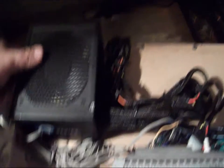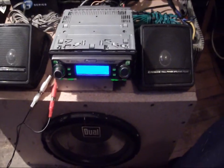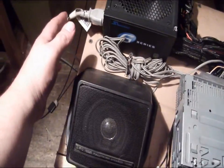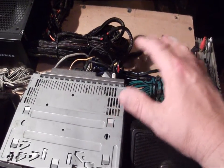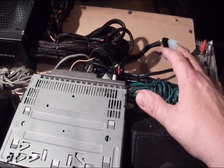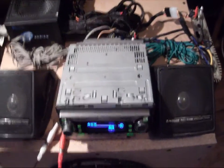This is a 350-watt power supply — not some big heavy-duty gaming machine. This is running the amp, the head unit, and the speakers. For right now, running it off the power supply, I just need the 110-volt plug-in to test the equipment. But I also plan to make a couple of Molex connectors with a long cable and alligator clips, so I'd be able to hook it right to a car battery and check stuff mobile too.